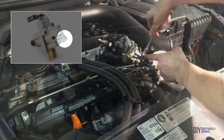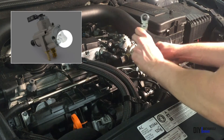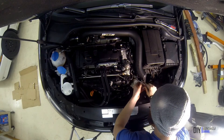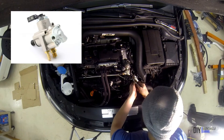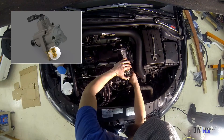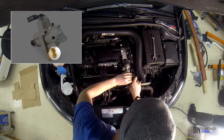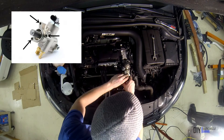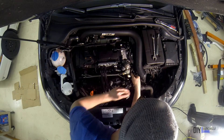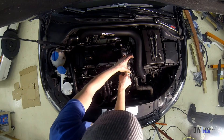Now that the pressure is released, we will need to fully remove the bleeder or Schrader valve so we can access the bottom high pressure fuel pump torx bolt. This can be removed with a 13 millimeter. Now we have access to that bottom torx bolt. But before we remove those bolts, we will want to disconnect the hard line coming up into the fuel pump from the bottom. This requires a 17 millimeter open end wrench to crack the nut loose, then it can be fully removed. You can just let that nut slide down into the bend of the hard line. With that removed, now we can go around and break the three T30 Torx bolts loose. With those bolts loose, continue to slowly remove the bolts, taking each out a little at a time. The high pressure fuel pump spring will keep tension on the bolt, so removing each bolt a little at a time will avoid binding or damaging the threads.